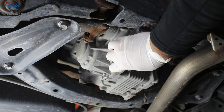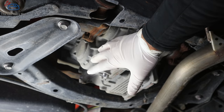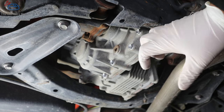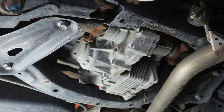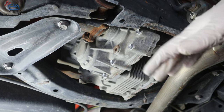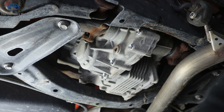It's a little essential to mention — you want to have the car level on four jack stands. It doesn't have to be measured level like building a frame of a house, but it has to be eyeball-level. A steep driveway is not level; only front or only rear jack stands is not level. I'm using the BendPak QuickJack which levels the car pretty well. Now that we have taken the fill plug, let's take the drain plug and drain the fluid.